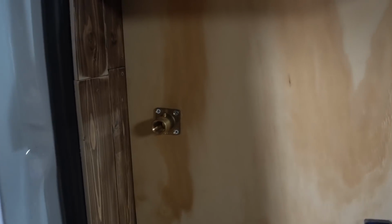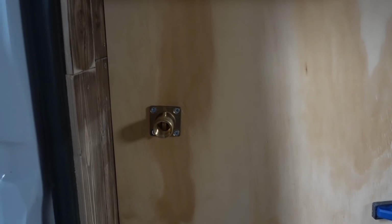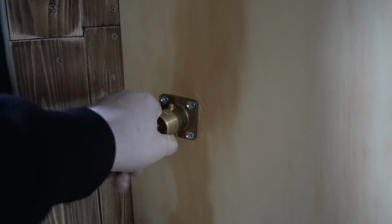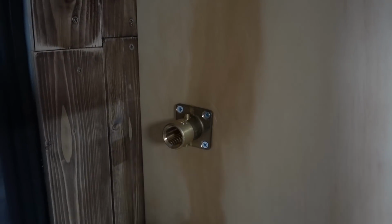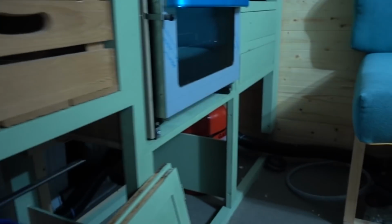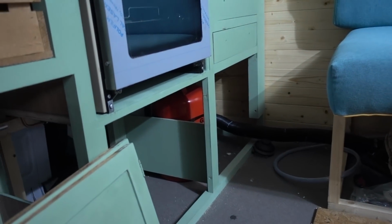So we've set it up so it's incredibly easy to fill up our LPG. If you go to a fuel station, you just open the sliding door and there is the fill point. We've got different adapters for when we're in different countries across Europe because they're not all the same. You just literally attach the fuel pump onto there, twist it, do a few things, and then it goes in. It's super fast, super simple. And the bottle stops before it's fully full because it's only supposed to be filled 80%.